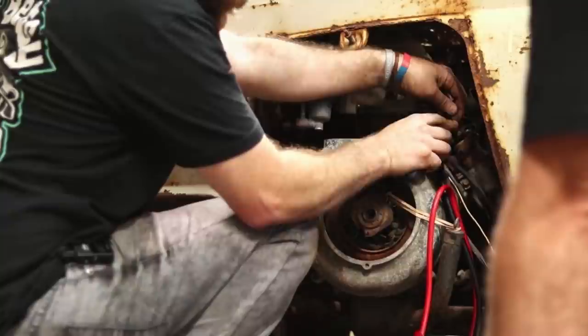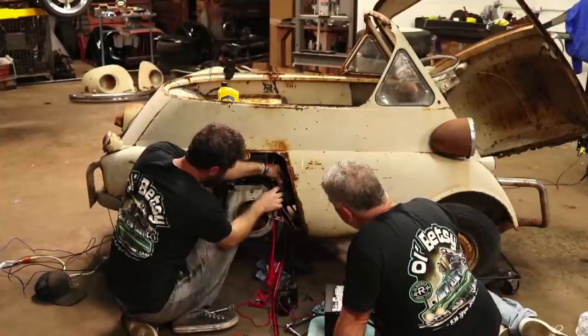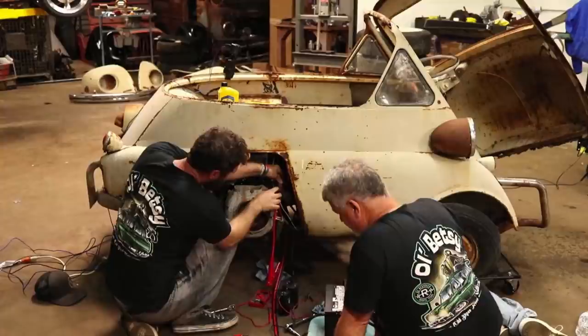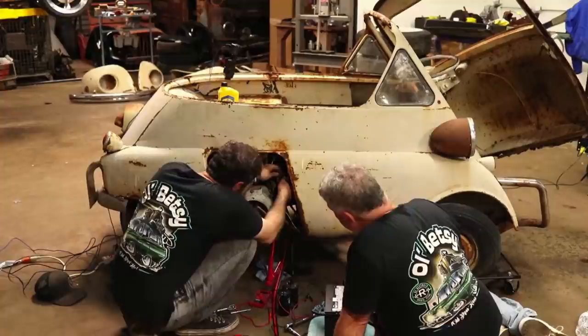Have a few people asking if it's got gas. No, we're not at that point yet. We're just trying to still get it to get spark at the points. We're still fighting that same problem, like Dad said, from the point destruction at the very beginning when the points broke. So if we can't get any fire to the spark plug, then we won't be doing any good here.